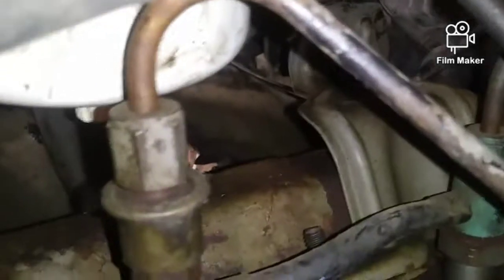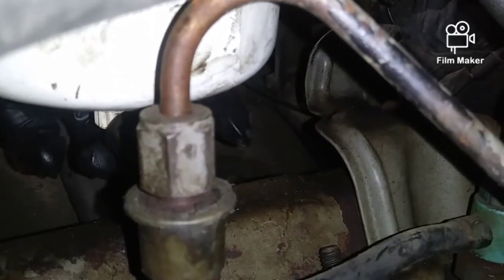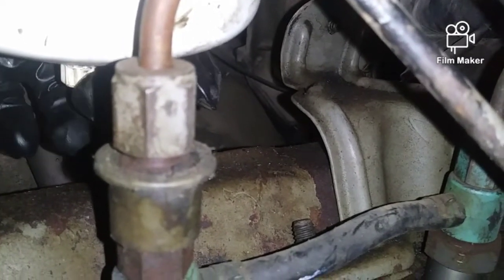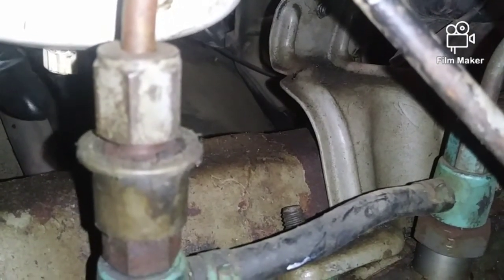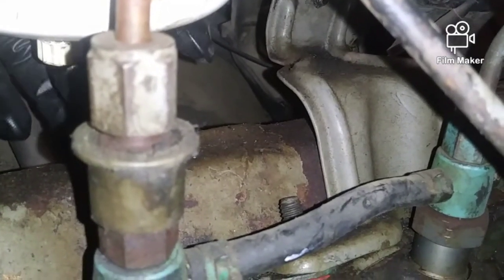And the other thing is, here is your aftermarket fuel filter, 33417, and I got rid of the cap. This one's deleted, and you can see on the bottom that if you were trying to troubleshoot, you can make sure there wasn't any water in your system. If you were to open this up, it wouldn't smell like diesel. It would smell off. So basically that would be water or contamination. You can inspect your fuel there.